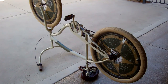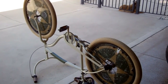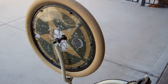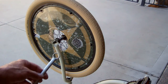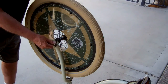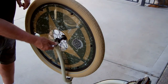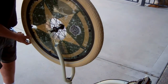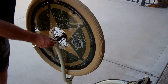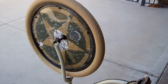I've got the bike tipped upside down — you could put a towel under the handlebars if you worry about scratching the grips. Let's start with the front wheel. Most of these bikes use a 15 millimeter wrench, so loosen the nuts on both sides and pay attention to your washers. Make sure you know which side the washer goes on in case you take the nut off. Then just go ahead and let the wheel off. To reinstall it, put the washers back where they were and tighten the nuts back up. Simple.